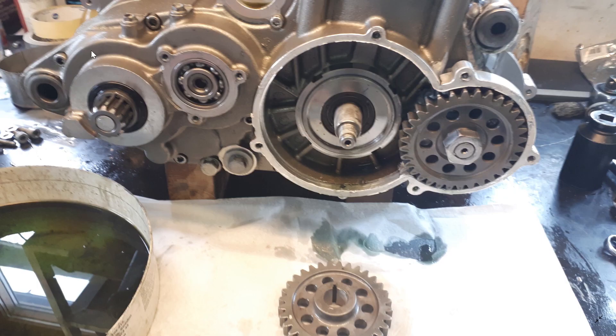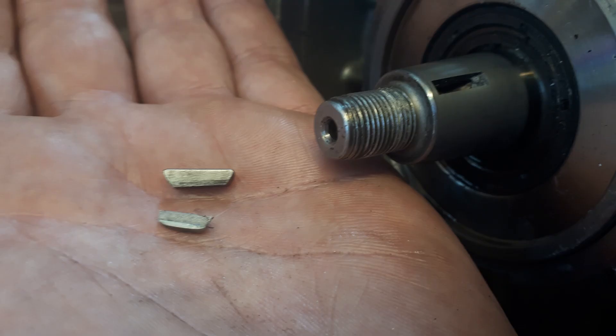At the second dyno test we did more testing and it was successful until the vibrations suddenly started to increase. So we called it off and back home in the workshop I could see that this gear situated on the crankshaft itself had turned a little bit — knocked off the Woodruff key and just turned a couple of degrees.